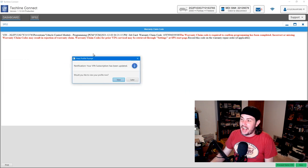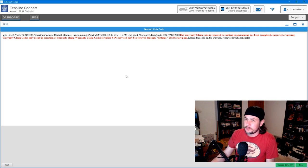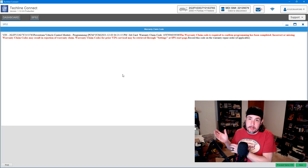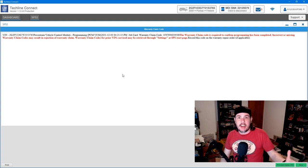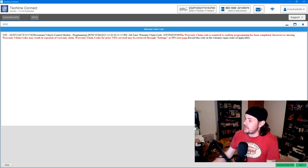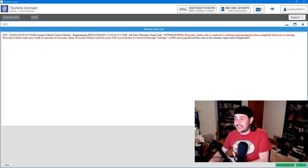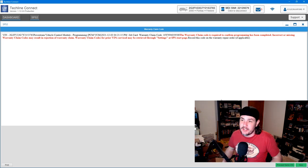Grandy doesn't have access to it, but the car runs on the tune right now. So this just means that he can swap these out, start tuning on this, and if for some reason he's having issues, he can go back to the one that's locked and go from there. So we're done with this. That's exactly it. We could proceed with the same VIN if we were doing multiple modules on a car that had multiple modules. That's not the case, especially because we're on a bench harness. That's the only one. And as you can see, this is a pretty straightforward, easy process.